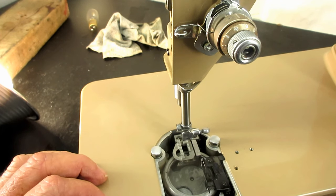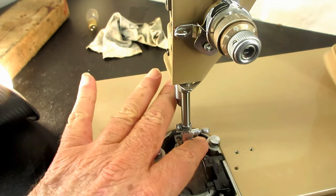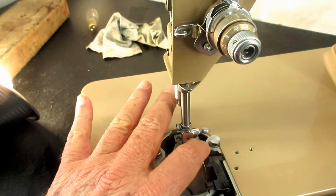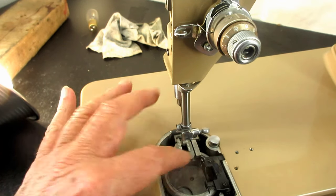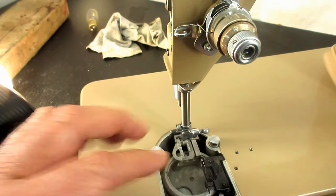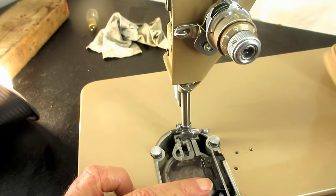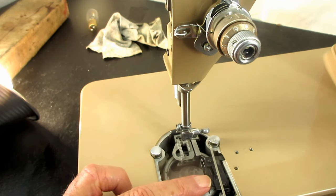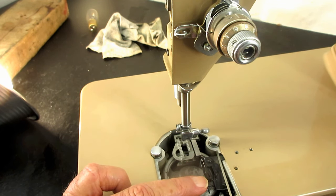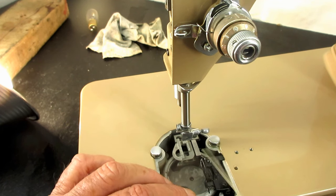And I want to put some oil at the edge of the tube. This steel tube goes through an aluminum ear cast into the body that holds the pin. And then the pin is hollow, and there's a little steel push pin inside. So down in that hole with the push pin, I want to put a couple of drops in there for that pin. And then right around the edge of the main lifting pin.